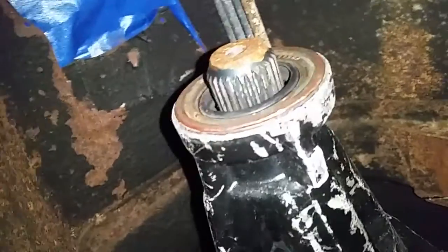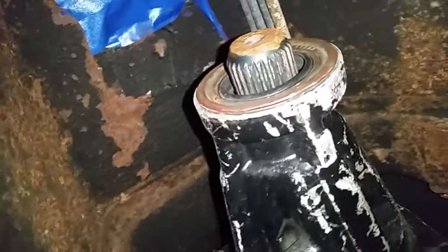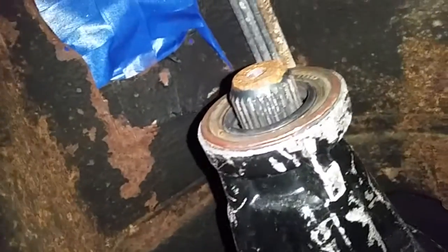Stay tuned. Hopefully as soon as I get the Corvette driveshaft I'll fit it and make sure it works. It's got a 27-spline yoke just like this Turbo 350 — I might need another yoke, but at 50 bucks you can't complain. I'm just putting the U-joints in it and go rock and roll.